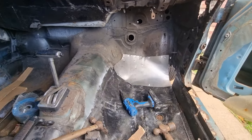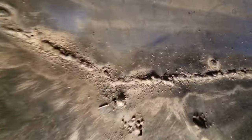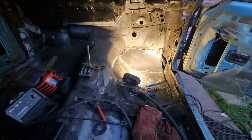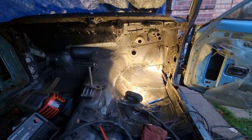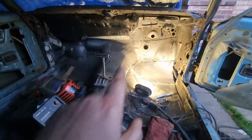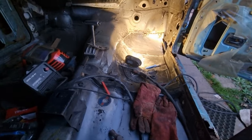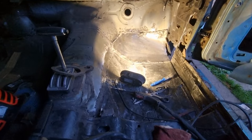Really getting back into this now — hopefully it'll look like that one soon. It's getting late, starting to get dark, but look how sick them welds are. They're 100% penetrating through the other side — I have really sick beads and they're definitely 100% coming out the other side. There are nuggets on the other side because I can see the weld arch and it's come through. All I've got to do is grind inside the arch. There is now officially no holes in this floor — done.